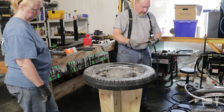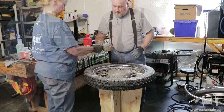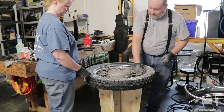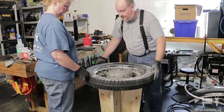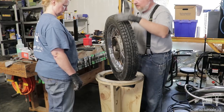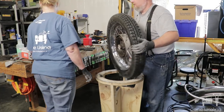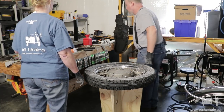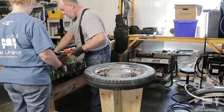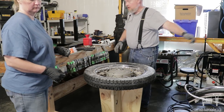This is where I kind of cheat using that tool. The bead is on so it can't come back off. The trick with this is not to get tempted to take bites that are too big. There it goes — like magic. I'll bring it up to about 45-50 PSI. That's pretty much it. Grease the rear spline on the bike — just take this toothbrush and get grease all over that rear spline all the way around. Doesn't take much.